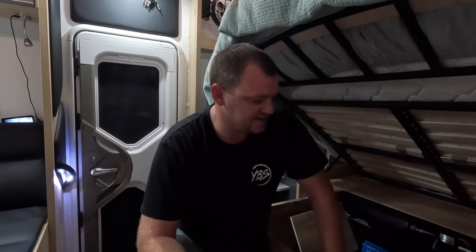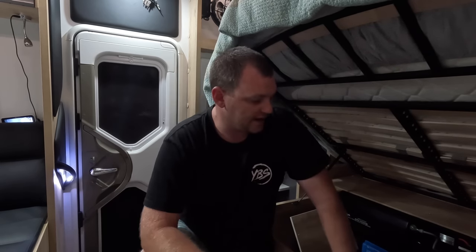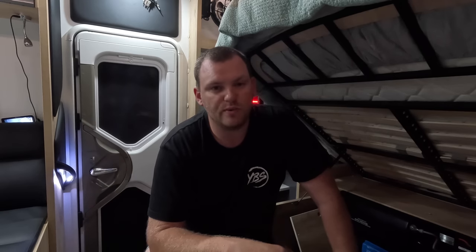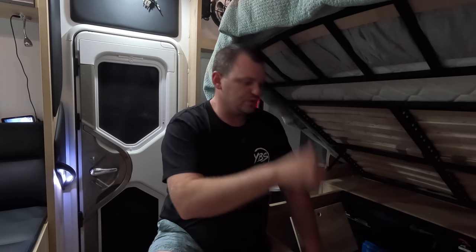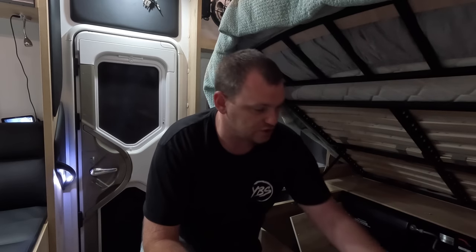We've finished installing the sender unit underneath the caravan. Now we're back inside the caravan, and I'm gonna show you where I put my Bluetooth receiver unit. You can put this anywhere that's convenient for you — I've opted to put it underneath the bed. You shouldn't ever need access to this because it's Bluetooth; it just talks directly to the app. You don't need internet reception or wifi or anything like that — you just need Bluetooth on your smartphone. It comes with 1.4 meters of cable, so I just needed to put it somewhere I could drill a hole in the floor and run that cable without needing any extensions.